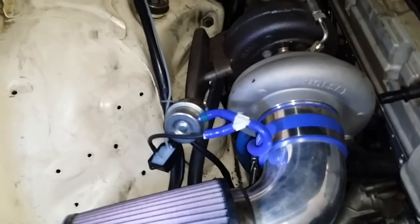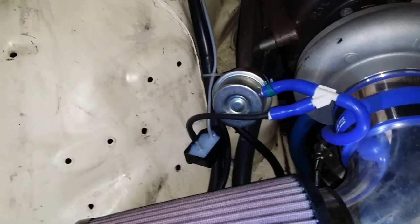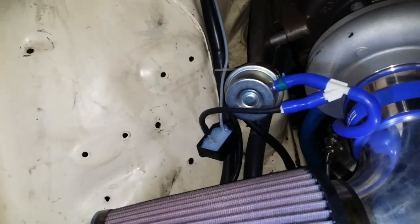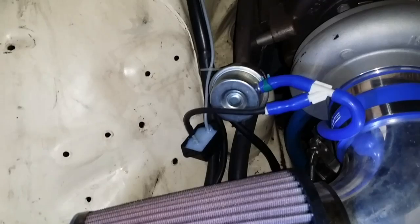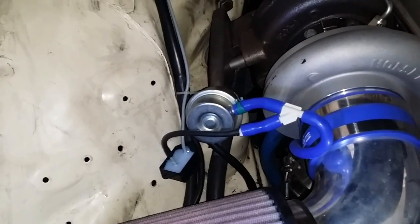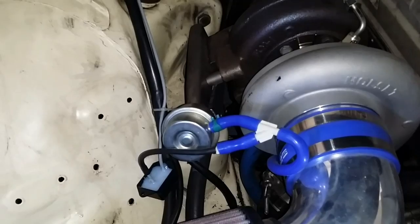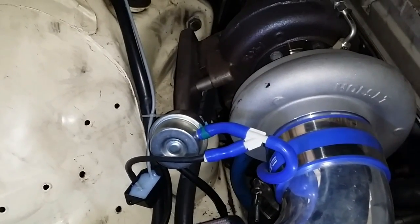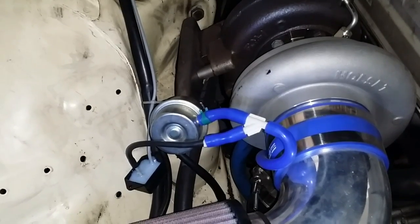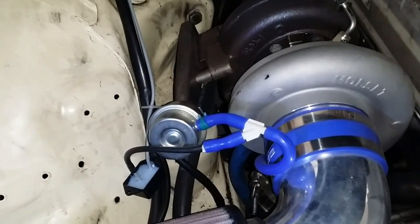I got the whole unit installed and already went for a test drive. The boost sensor is just mounted in line with the actuator for the wastegate — I know it looks sloppy, I just want to see it work, and it does. Initially I had a problem where it wouldn't come out of first. What happened is the cable going into the side of the transmission wasn't seated all the way. Once I took the connector out, pushed it back in, and made sure it was seated properly, I'm shifting just fine.